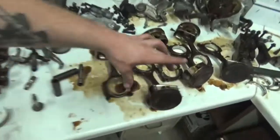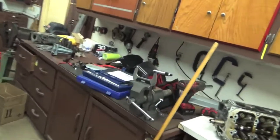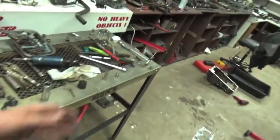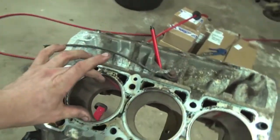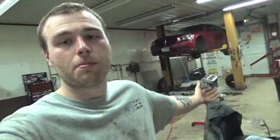I took my micrometer and measured the actual piston diameter - it measured in spec. Then we hooked up our micrometer to the bench vise, set up our dial bore gauge, and checked piston-to-bore clearance and bore taper. We got basically no taper at all - like one ten-thousandth, it was stupid close, perfect bore. Piston-to-cylinder wall clearance is four thousandths, which is good - four to six thousandths is perfect. Now we're going to hone the block, then take it outside and clean it with the pressure washer and engine degreaser, then set up the parts washer and clean the heads and crank, and start checking bearing clearances.